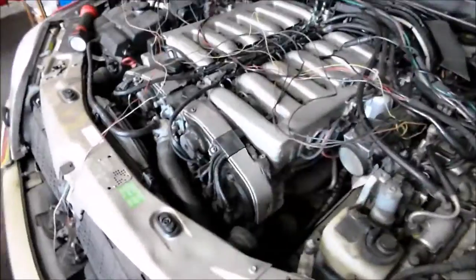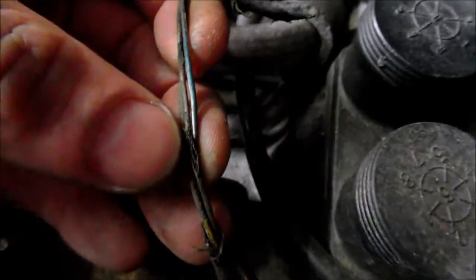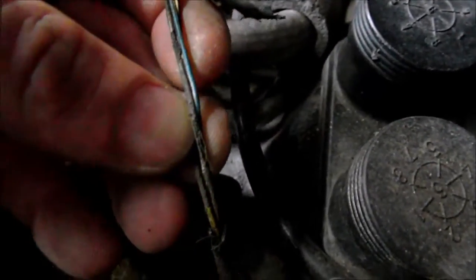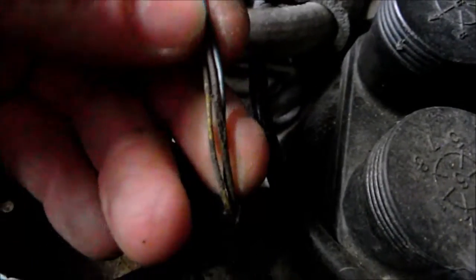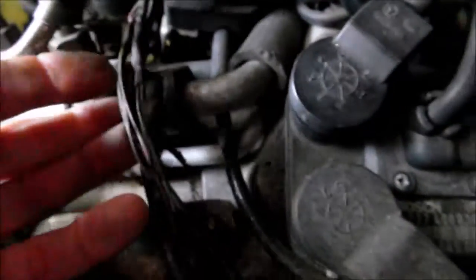The water pump is leaking, but that's the least of the concerns at this point. There is also a little bit of damage on the lateral acceleration sensor — there's a little bit of corrosion here. It looks like there was some melting accident here. I don't know how it happened, but I would replace that. I'll take care of that later.